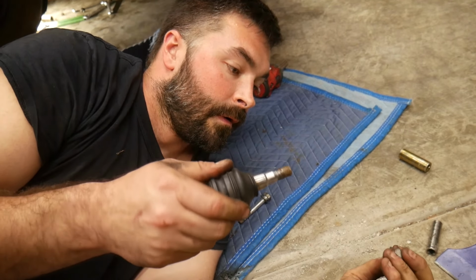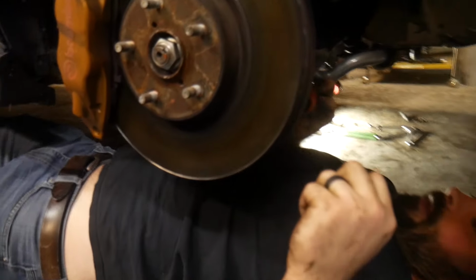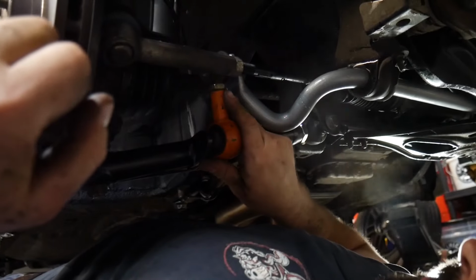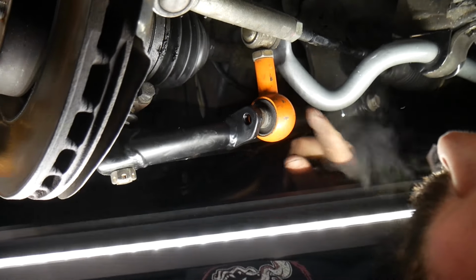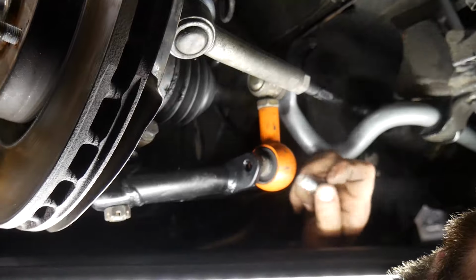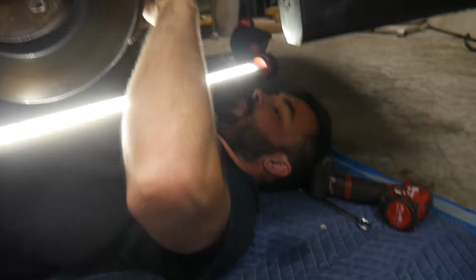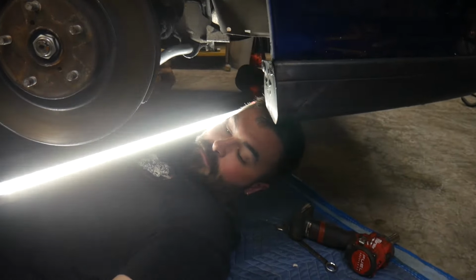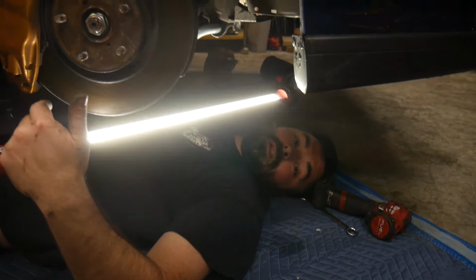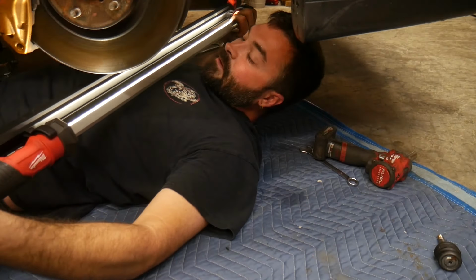So we got through that debacle, but now what I've run into is that these aftermarket end links that I got hit the control arm before they ever line up to this tab. It hits the control arm before the bolt gets centered, so you can't get the bolt through. So I need to get new slim line end links for the front of this bad boy. TSS Fab did supply their own sway bar end links when I got the rear subframe, lateral links and trailing arms, but for the fronts, it looks like I'm going to have to order something smaller.